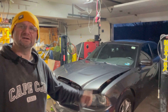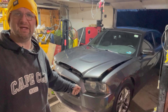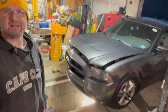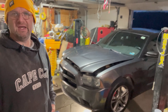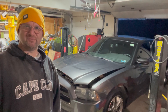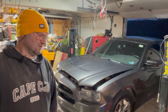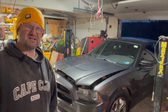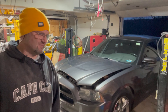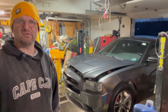Alright ladies and gentlemen, we got the next project on the list. I just finished making a slide tray and cleaning the pit in the bottom of the garage. Now I gotta change the oil in the hemi — this is a 2014 Dodge Charger RT all-wheel drive. It should take 6.9 to 7 quarts with the filter, and I believe it takes 5W-20 full synthetic engine oil. I'll double check before we pour it in.